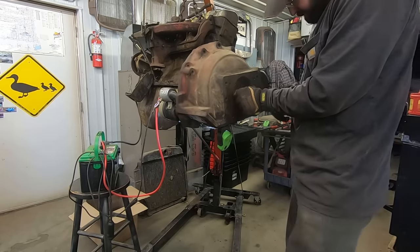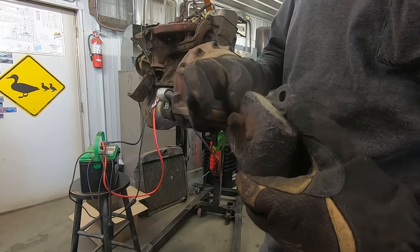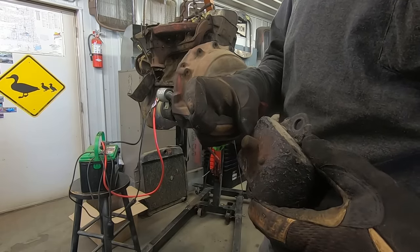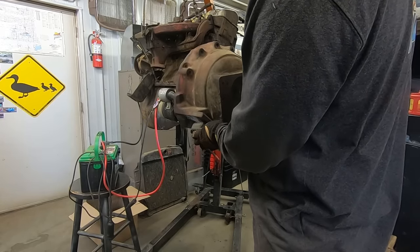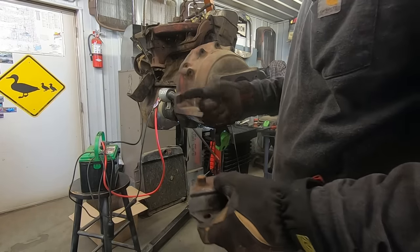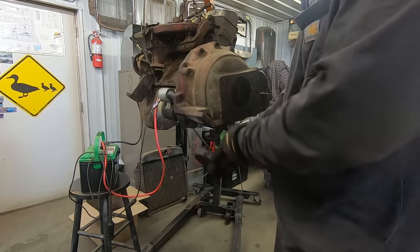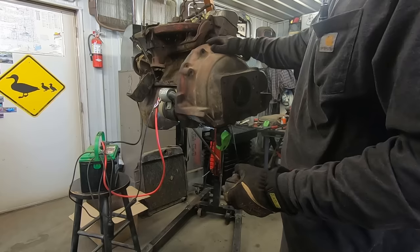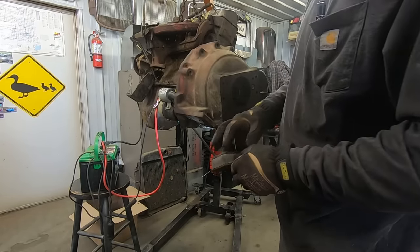No, I have not. So here's the story on these engine mounts. This looks like a nub. Should be a bolt about yay long. And you gotta bolt these to the block before you slide it in place. And I didn't do that. I got it all in place last time. And there's not enough room to fit these, to lift the engine up, because the bell housing hits the floor pan, the transmission tunnel. And you can't sneak these in there. So I had to cut these off.